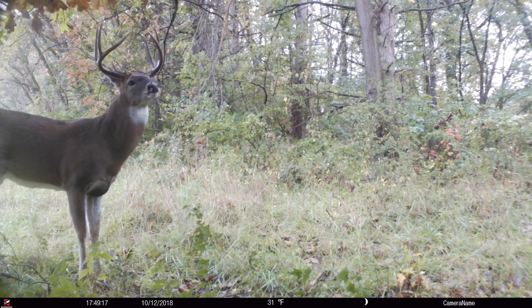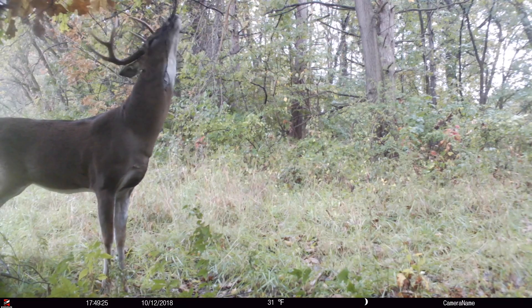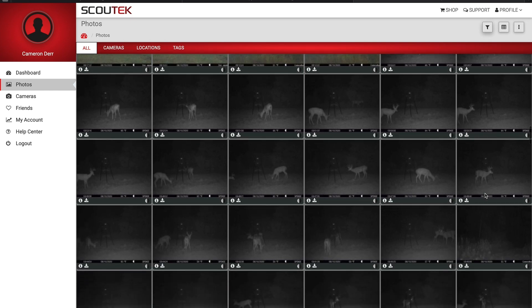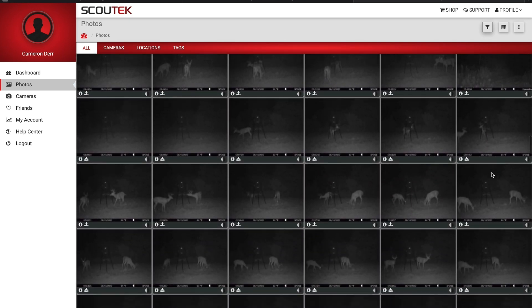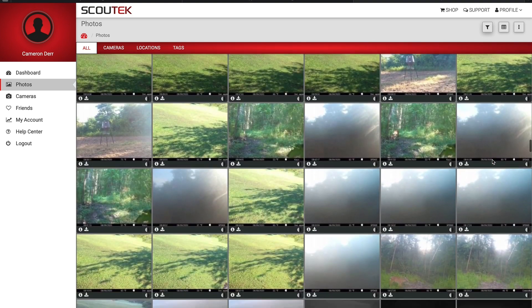As you're stepped off to the side and the camera has gone through its 30-second countdown with the screen asleep, check your phone for a status report. In the on position, after the camera gains signal, it's going to send a status report. After you get that initial status report from the on position, we recommend physically walking in front of that camera once or twice, making sure it's taking photos and being uploaded and sent to your phone. The last thing you want is to leave the camera location and find out something's gone haywire — maybe your cord has come unplugged from your external power source. So before you leave, just do a simple walk test. Once or twice across that detection zone is going to ensure you're getting pictures sent to your phone.